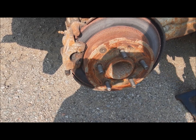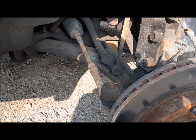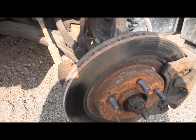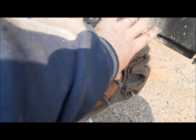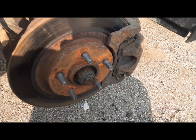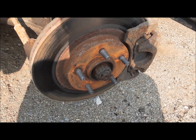Parts will be here in a couple of days. We'll have a good fast look in here and make sure we don't see any nasty wet spots or broken parts. Sometimes you'll see sway bar links busted off or whatever — I already gave it the jiggle test and it passed. You've also got to make sure before you put your wheels on that the faces of the brake rotors are clean. A lump or a speck of gravel can give you a wobbly wheel, bad torque, or even a loose wheel.